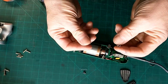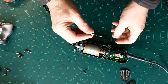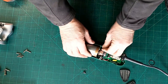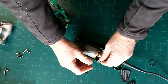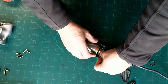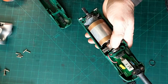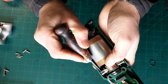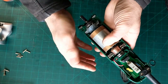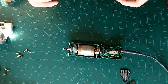Brushes in. So the brushes are going to sit in here and we've got a curve already on them — they're not bad, probably worn a fair bit but they'll still be all right. What we're going to do is feed that spring inside, line it up on top, feed that in, hold it in, push it against the commutator ring, and lock it down in place. Do the same with this one — line it up into there, take that brush, line it around the right way, circle it on the end, push it against that commutator ring, and then lock them into place. What we're looking for is that little pin actually catches in — anywhere else and it would be in the wrong spot.